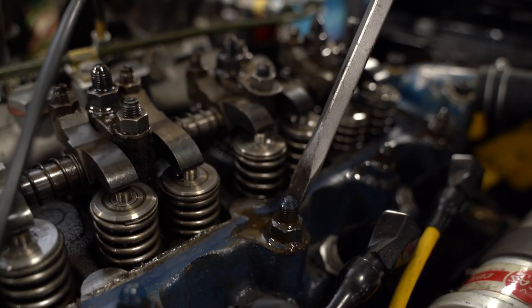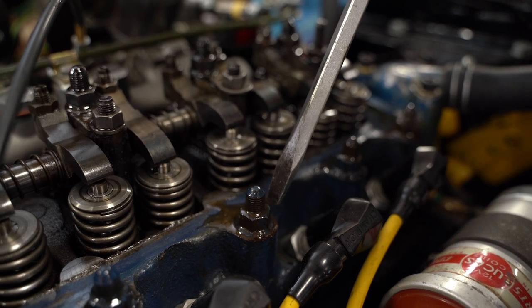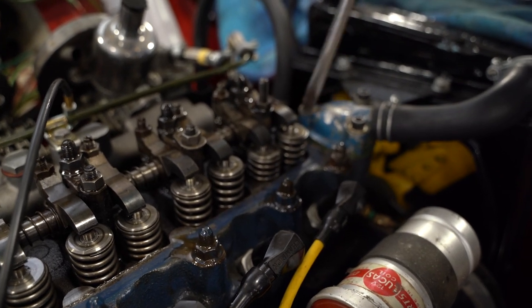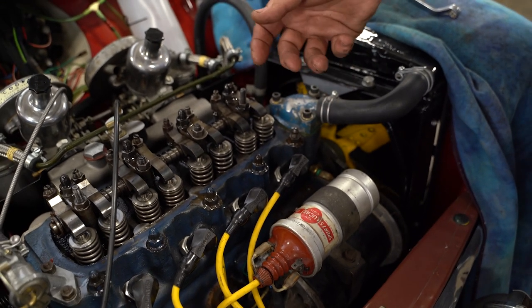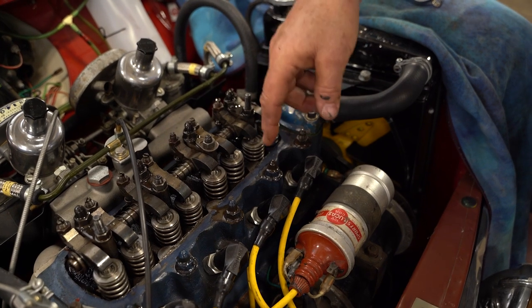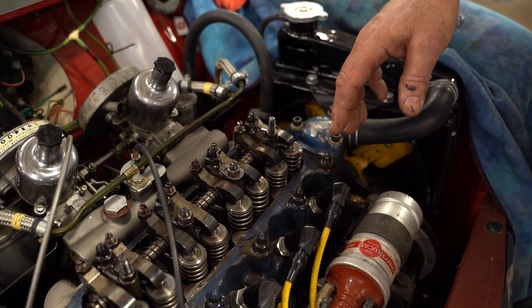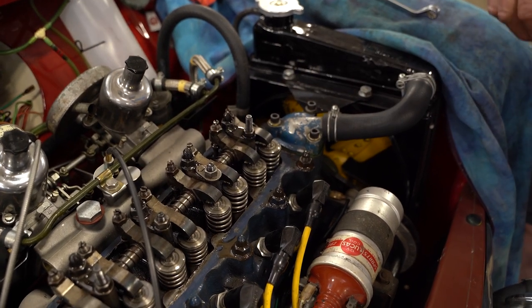Anyway, the studs that came out, I just went over to the vise, put them in the vise and unscrewed the nut. One of them could almost turn off with my finger. Then I put a little grease on them and put them back in the engine with my stud driver, maybe to 5 pounds. The stud driver does mar the threads. It's got three or four rollers and puts little marks on the thread, but this isn't an aircraft engine, so you don't have to be that critical. Anyway, I got them all torqued down to 55, and now I'm going to adjust the valves.